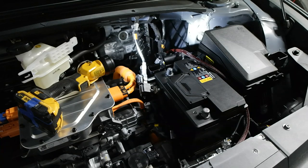So there's actually a, I think 60 amp is what they specify from Rockford Fosgate for that particular amp for the fuse. There's going to be a 120 amp fuse up here, and then in the secondary spot there's a 40 amp fuse that will be used later on. So let's get down to the wiring.